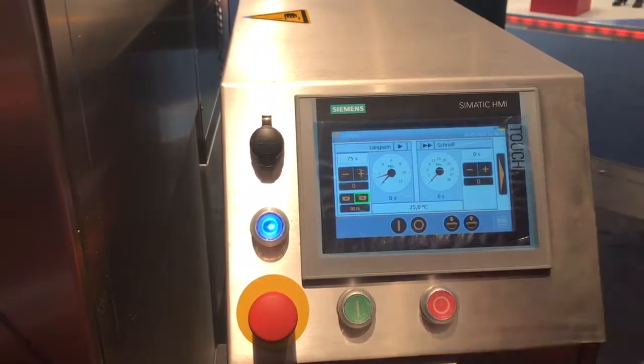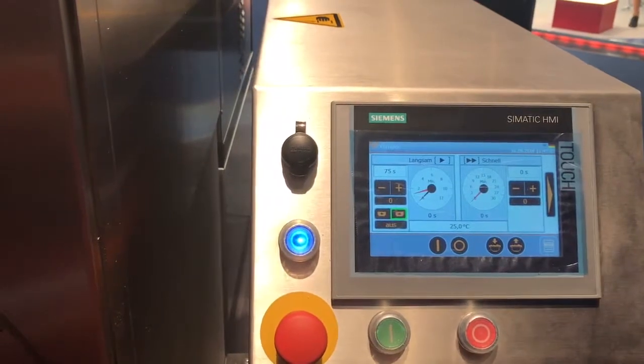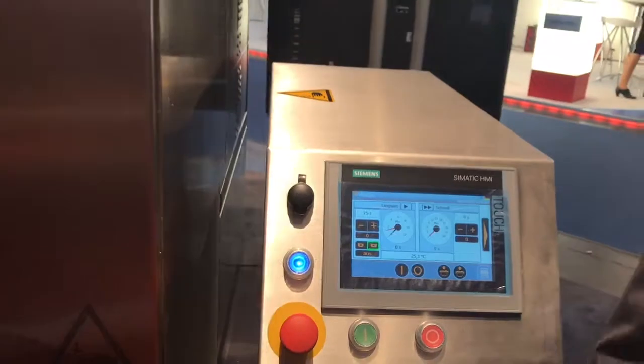So I can go in there and say, for the first step, of course, it's going to be mixing. You start in slow speed, and I can tell it I'm going to mix for 2 minutes, and then after the 2 minutes, kick it into high speed for the kneading. But 5 minutes into it, I might want to add another product, salt or anything, and I can program it so it will stop. If it's something I need to open up for, it'll lift up, wait for me, I put it back in again, I hit the button, and it starts up again.